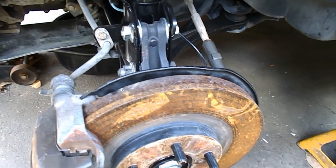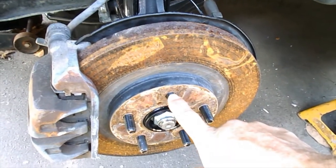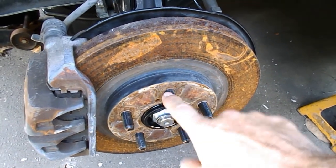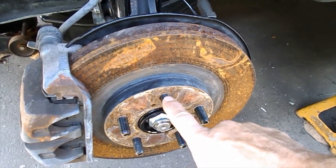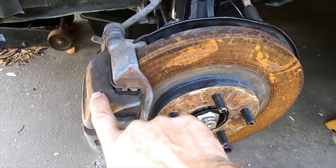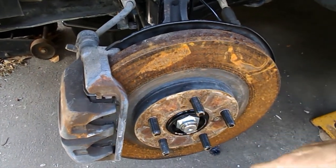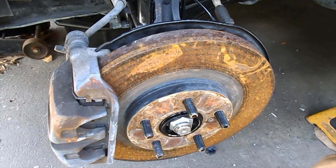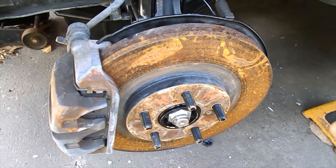I'm making this look simpler than it is. The main benefits are: you get a bolt-on wheel bearing assembly, and you can upgrade to the Honda Pilot brakes which have a bigger caliper and a slightly bigger rotor. Those two things combined made it intriguing enough to try. Next videos will cover the passenger side in more detail.